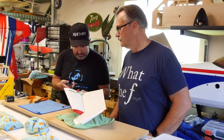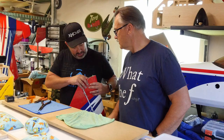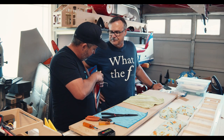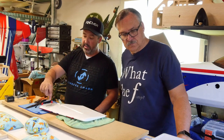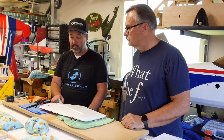We can get her in there. Wiggling it in and now the servo is installed. You see the servo's in there. Then all you do is use your driver, pull your arm off, and put your regular arm in. I'm going to use some clamping arms from JR — I have some from DA as well. You can use the hole that lines up to tighten that down and your servo's in. It doesn't scratch up the servo. I used to try and grab the outside edges of the case to work the servo in, but it just doesn't work.